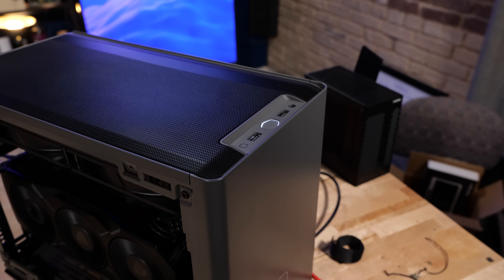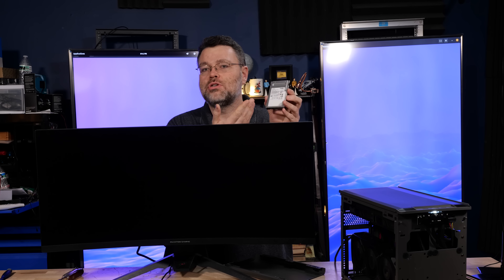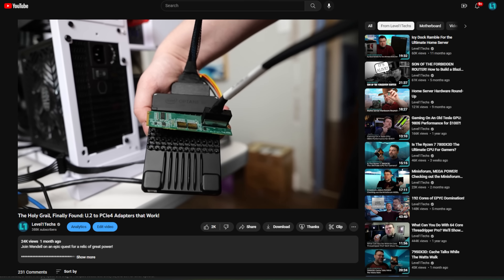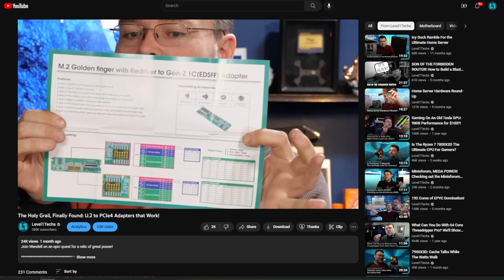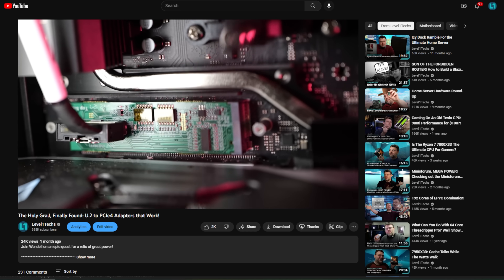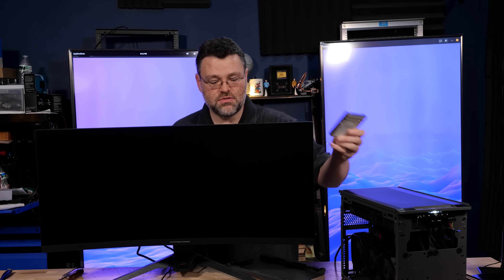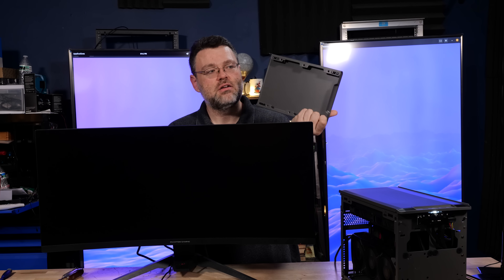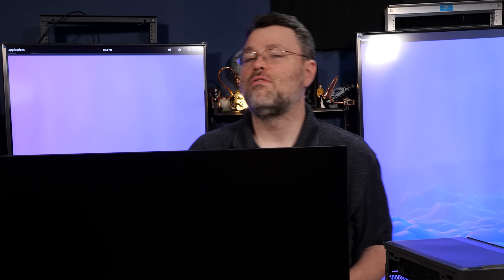You still have USB-C at the rear, but it would be nice if Cooler Master had a version with front USB-C. The front panel is removable, and this is one of the few cases where you could use a U.2 enterprise-class drive using an M.2 breakout cable or M.2 to U.2 adapters. You can use the rear M.2 with a PCIe 3 to U.2 cable going from the back of the motherboard to the device. There's physically enough room to mount it in the front, with 15mm of clearance, so you can get airflow to a smaller or hot-running drive.